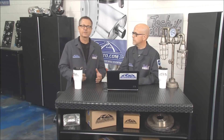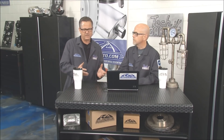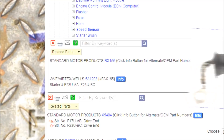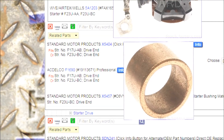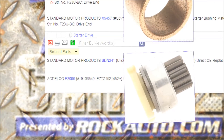Tom, we looked inside of a starter, and I know there are folks out there with an old vehicle who maybe don't want to replace the whole starter with a reman or a new starter. Do you have an option to rebuild it? Sure — some starters are prone to brush wear. We have the brushes, the bushings, and the solenoids. We also have remanufactured starters. And something that's been out the last decade now is completely new starters for old cars, so you can start from scratch. You don't have to return a core, which is especially handy with Rock Auto — you don't have to ship a core back to us.